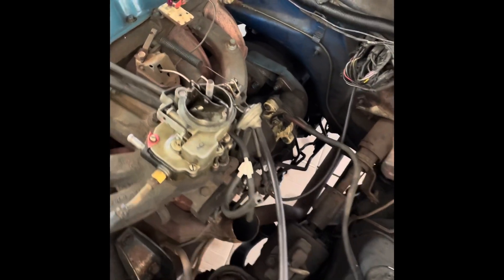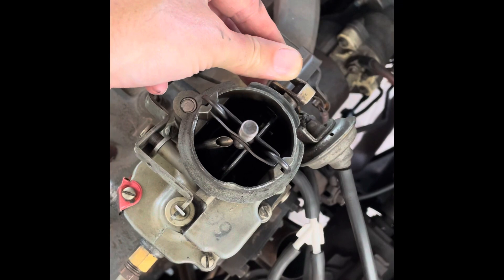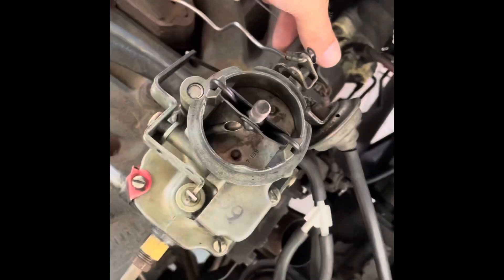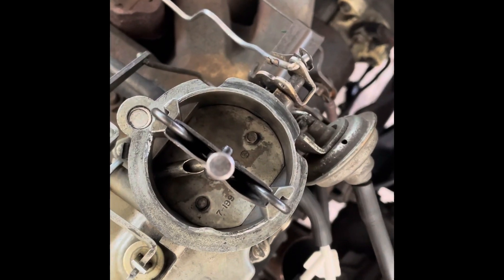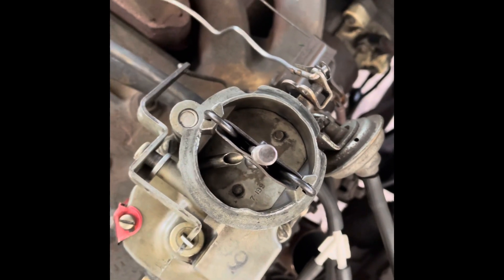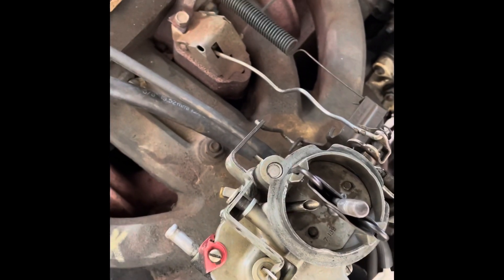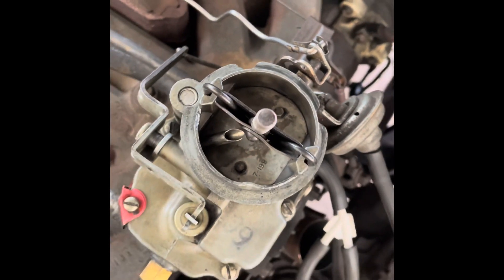This is a cold engine. On a cold engine, the choke will have been open from your prior drive, but when you hit the throttle it snaps shut. You want full choke when you're cranking — that gets the engine to suck as much gas as possible out of the carburetor. You might wonder how the engine breathes when it's completely choked off, but don't worry about that.